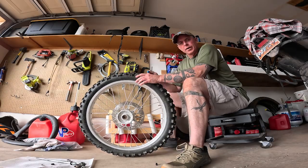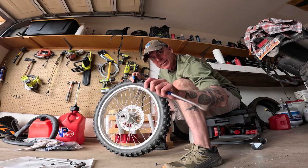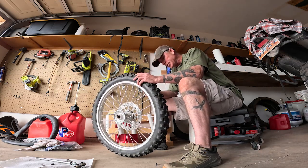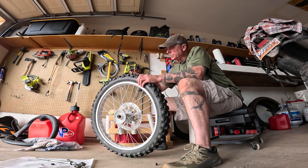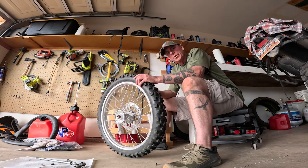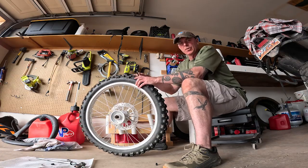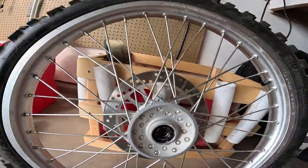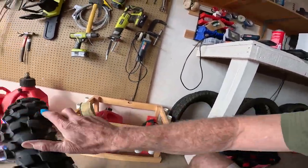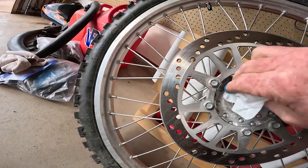I'm just going to give it a few minutes and see if I'm losing air with the tire, and if not, I feel pretty secure about putting it on the bike. So I took a break and left for an hour. I actually went to Rocky Mountain ATV and got a couple more spoons and some more 21-inch tubes. I wanted to see if this thing was holding air — yep, still at 20 PSI. I didn't pinch the tube that second time. Cleaning these out before I put the axle back in.